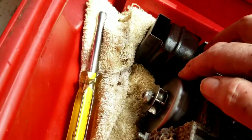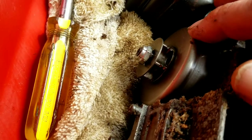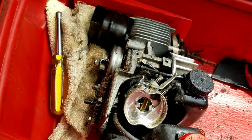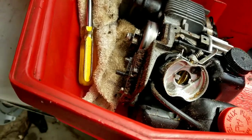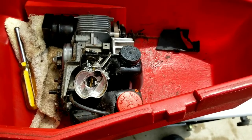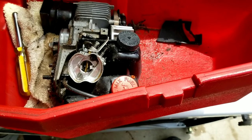We can see the clutch mechanism on this saw. The drive sprocket does show some wear, and that's going to affect how the chain pulls. Honestly, this is a rather old and cheap saw, so it's not going to be worth putting a lot of extra money into. We're not even going to rebuild the carburetor — we're just going to take it apart and clean it. The air cleaner is also a little decomposed, so we'd better take it apart and clean it to make sure there's no debris inside.